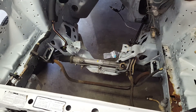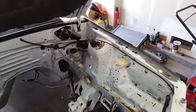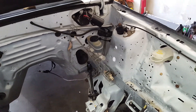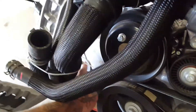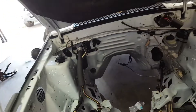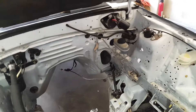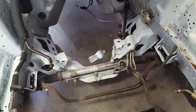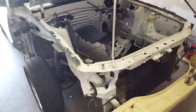I'm going with a Flaming River manual steering rack and manual brakes. The reason you have to convert to manual brakes is the booster itself is going to hit the motor. You have two options: either convert to hydro boost from a 99 to 04 and retain power steering — which requires brackets to move the alternator, power steering lines, and hydro boost lines — or go with the Maximum Motorsport manual brake kit and manual rack, which is what I chose.